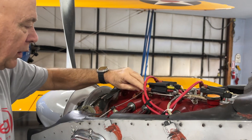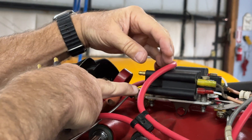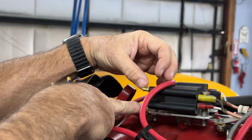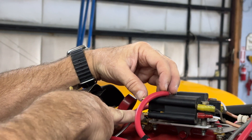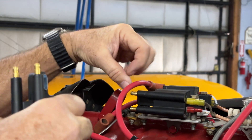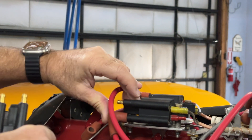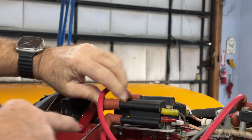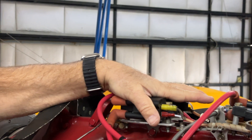To tell if you've got a bad coil, pull off the spark plug wires and take an ohmmeter and measure across the two terminals. The way I've seen these coils fail is they'll go to a very low resistance because a winding gets shorted out inside. Typically you should see about 8,000 to 8,500 ohms across those two terminals — if you have less than that, it's time to replace the coil. When you put these on, I'll use some Dow 4 on each connection to keep corrosion down, especially in a wet environment.